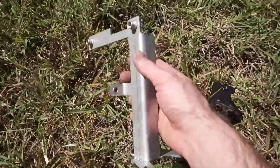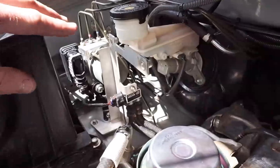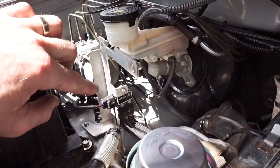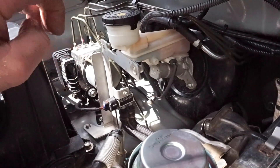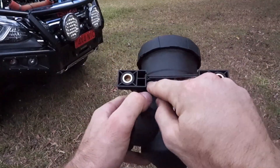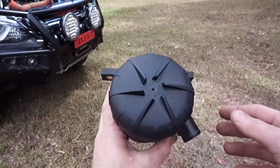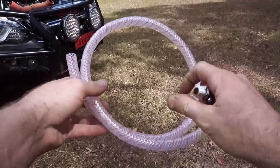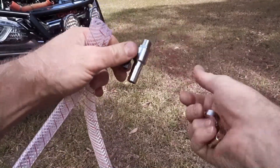Now we can fit the nice stainless steel Western Filters bracket for our catch can, and the DPF pressure sensor mounts onto it as well. I've finished mounting the catch can bracket — you reuse the factory bolts at the bottom and the factory bolt for the DPF pressure sensor. The bracket fits in really nicely, it's neat and perfectly cut for that location, and it's stainless steel so it won't rust. I've rotated the mount slightly — you just pop it off, rotate around, and pop it back on to get the hoses in the right position. The drainage tube is clear so you can see the oil level; it comes with a release valve for the bottom of the hose and a couple of hose clamps.